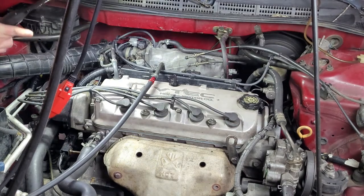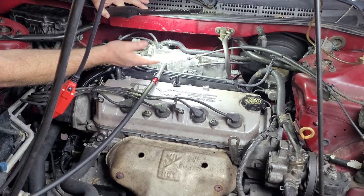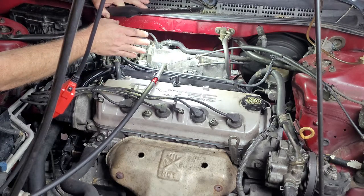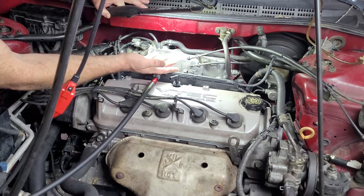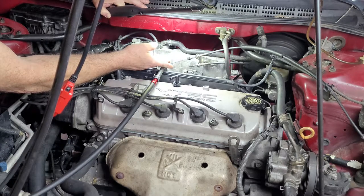If you're checking the system and you start seeing smoke come up around your intake manifold, any of the seams, or any of your vacuum lines, I suggest you get under the car and make sure you can see where it actually originated — because everything's going to be trying to come up rather than go down. You may think it's leaking right there, but it could actually be leaking from somewhere underneath that point. Track it down and watch it come out from where it's originating. Don't assume.